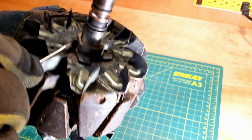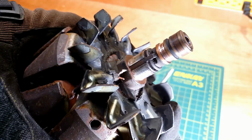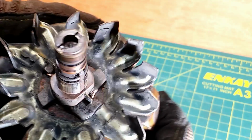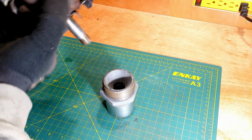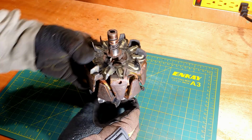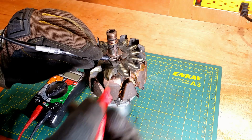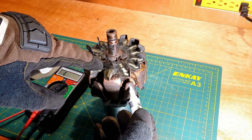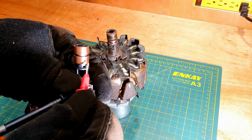I start with disconnecting rotor wires from the metal connectors at the base. The wires are spot welded and can be easily removed with a small screwdriver. One is ready. The two are undone. I make a stand for it and now we'll check which ring connects where. I make a mark on which side is the bottom ring connected. And mark the side of the bottom ring connection on the new slip ring.